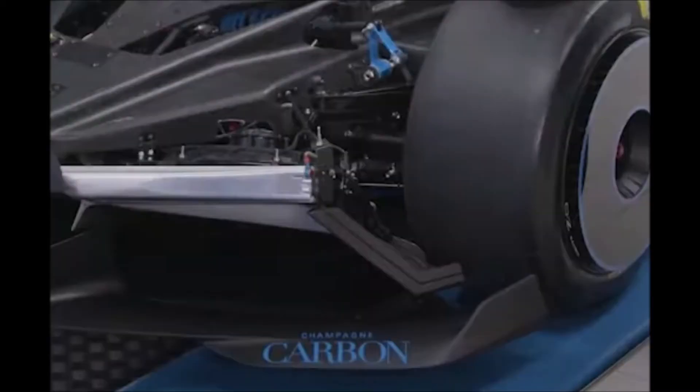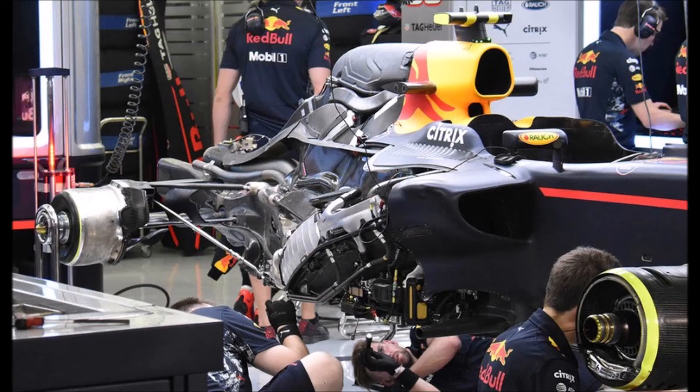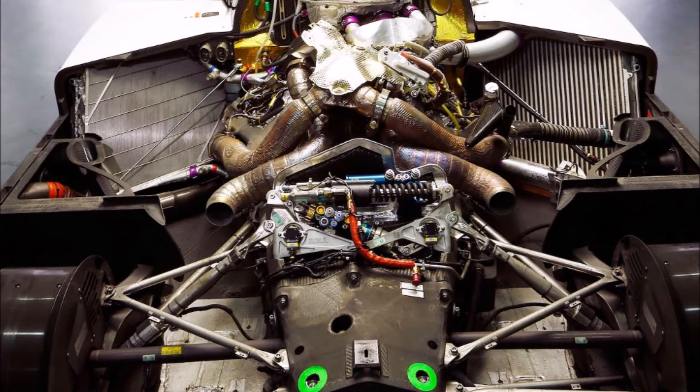One thing that's very interesting in this shot is that we can see they have a bent shape — so we have bent radiators, which is absolutely not common for production cars. They are common in Formula 1, but they won't even be allowed in Formula 1 from 2022, and I don't know any other motorsport category that's using these bent radiators. Production cars never use them because it's pretty expensive, and it's quite impressive to see them here.